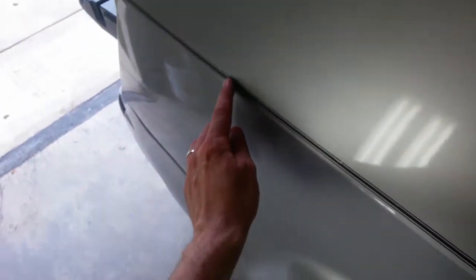This has all been painted over - I can tell work was done down here, and on top of that up here, I think from a hail storm a few years ago. The whole top was reworked and taped along the stripe. You can see that edge and the edge of the clear starting to come up, so there's not really enough room to tape at the bottom of the stripe without building it up too thick - you'd be able to see a step in the paint at that angle.